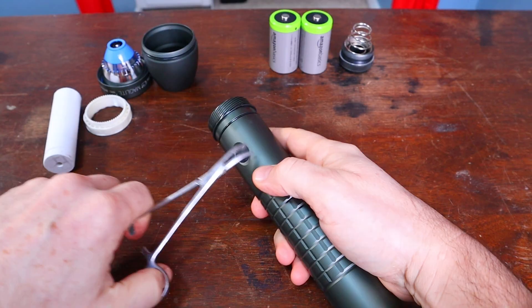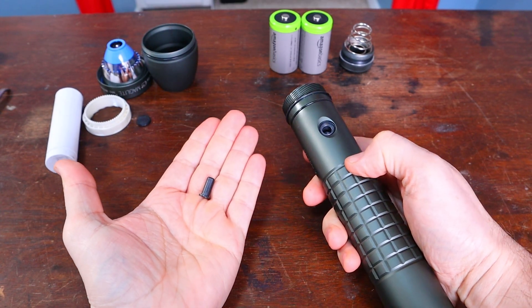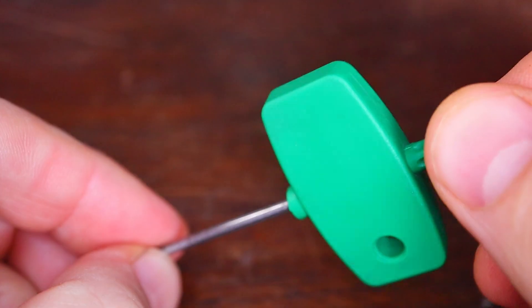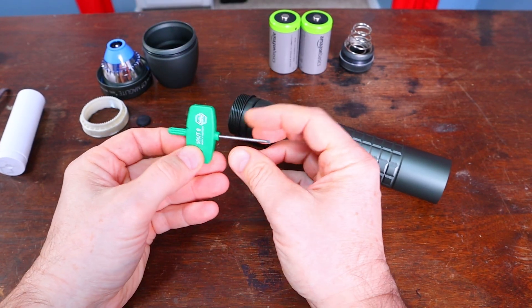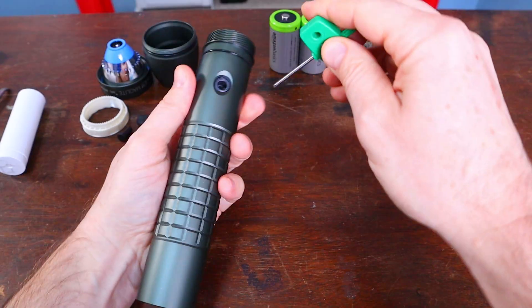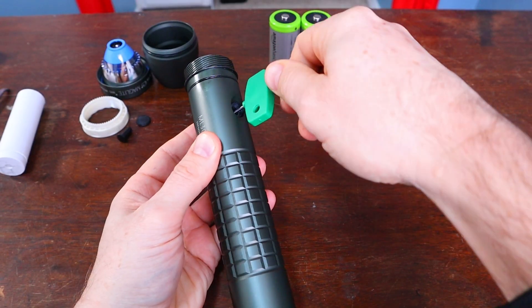You've got to take that boot out with pliers or hemostats — it just pulls off and then that button falls out. To get in there we need a T8 Torx wrench. A lot of times the shaft on these will not be narrow enough, so you have to file, grind, or sand them down. Just stick your Torx right straight into that hole and you'll feel it kind of lock, then crack that loose.